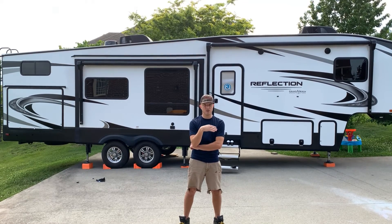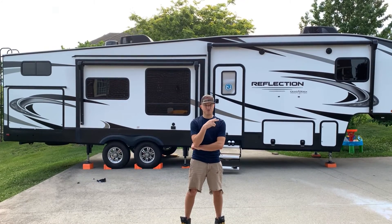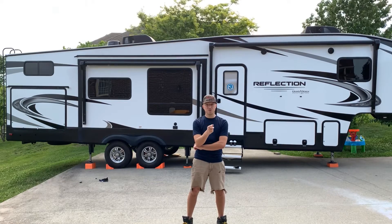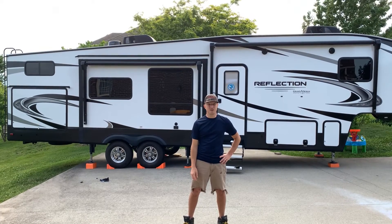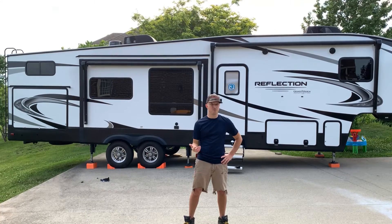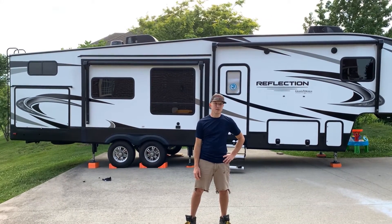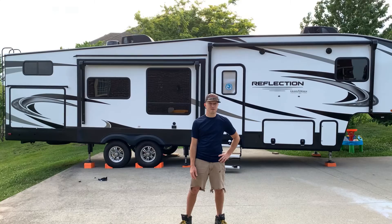The following weekend we did a 120-mile round trip. On small hills up and down I never felt the trailer pushing my truck forward — these really make a huge difference. I'd really promote this as a safety priority when weighing what to tackle first. It's kind of unbelievable that they'll sell a 10,000-plus pound trailer without disc brakes when the technology is pretty easy to do. If you can change out a caliper on your car, you can do this project. Feel free to leave comments below — I'll provide whatever help I can. Thanks for watching.